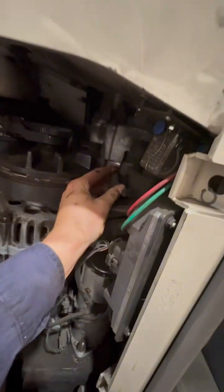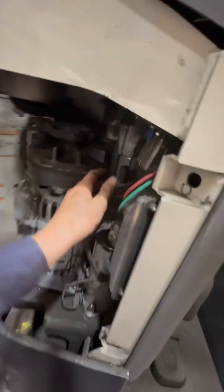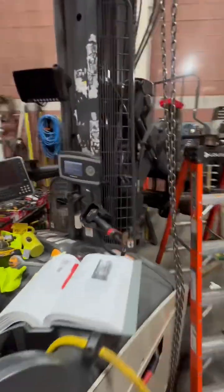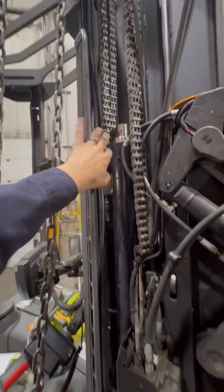Also, while I did that, if you come back here to your PVM valve — it's this little dial right here — this relieves all hydraulic pressure on your reach. So I just lowered that down. This is where it stopped for me; I'm assuming it'll stop right there.